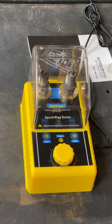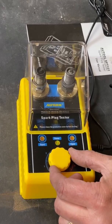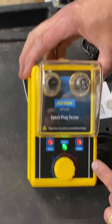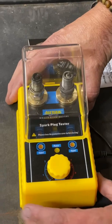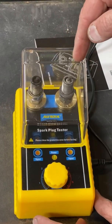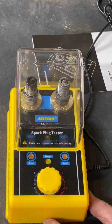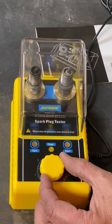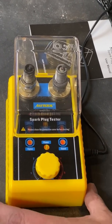Power light is on and we're right now at zero RPM, so I'm gonna crank it up a little bit. We're getting a pretty strong signal light on this spark plug, but not too much on that one. If you can see in here, the spark itself — I can see it on that electrode, but I can barely see it on that spark plug. Let's go up to 2,000 RPMs.